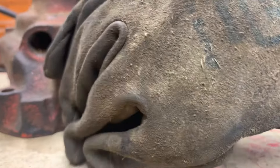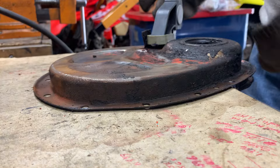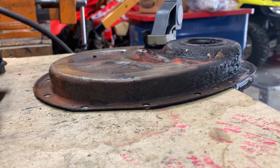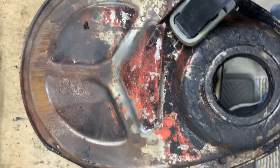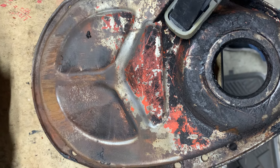Here's the water pump. I'm going to move it forward and drag it back towards the timing cover. You can obviously hear that scratching on the timing cover, which means that I believe these things touch each other from the factory. You can also see, looking down at the timing cover, where I've been moving the water pump back and forth — you can see how it drags on the timing cover itself.